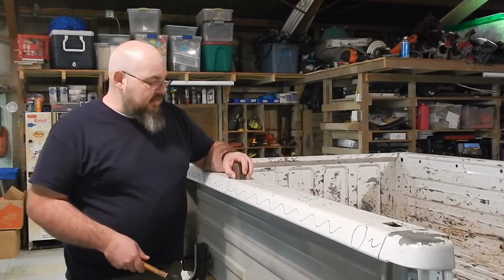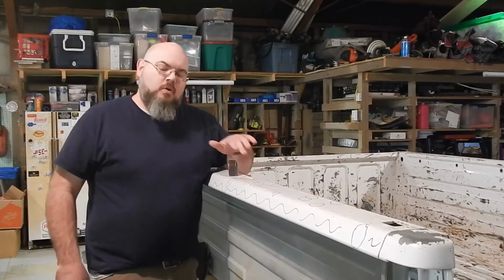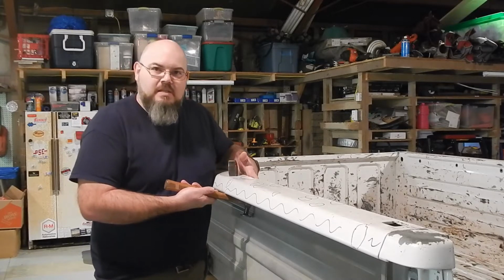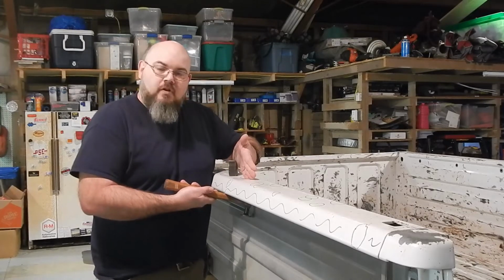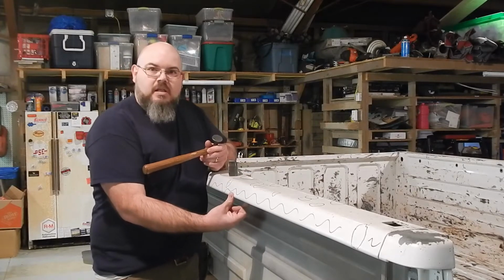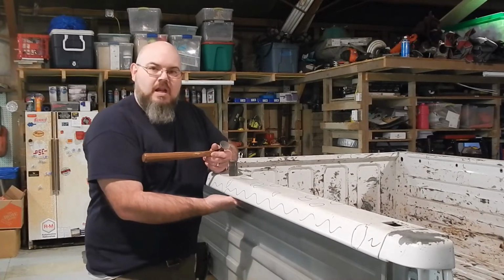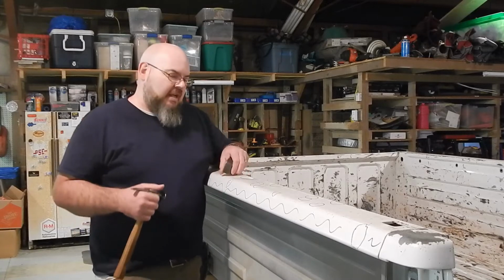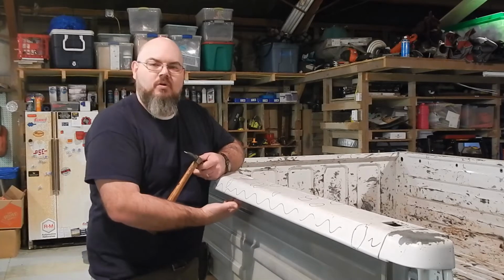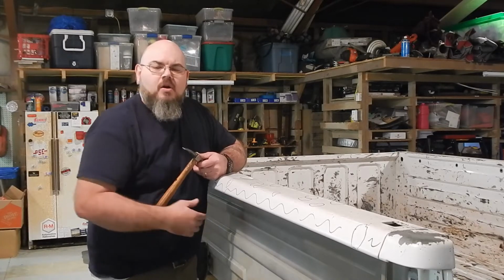But we're going to have access to this one, the inside one, that one that I was talking about being real deep, guys. That's the one we're going to have a hard time getting to, because our hammer isn't going to reach that direction. Basically, our hammer is going to land further inside, even with it up against the inside, because of the way the bed's contoured on the inside. And there's a couple inch lip here where that bedside bolts to, so we don't have 100% access, but we can do pretty good with where these dents are located. What we're going to actually do in a few minutes, though, I'm going to show you how to kind of cheat and drive that up without dent pulling, because like I said, especially up here, it's going to be hard to corrosion proof this. So especially once the bedsides are on, you're not going to be able to get up there with a corrosion protection.